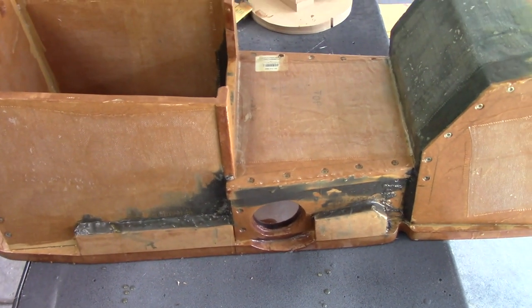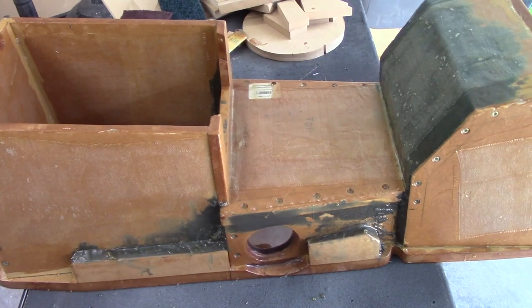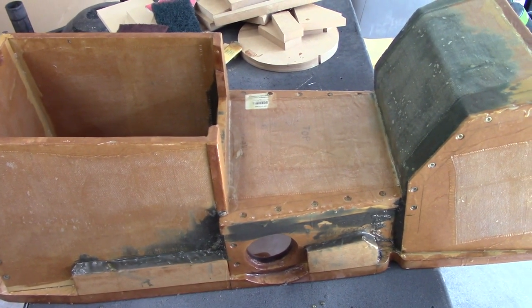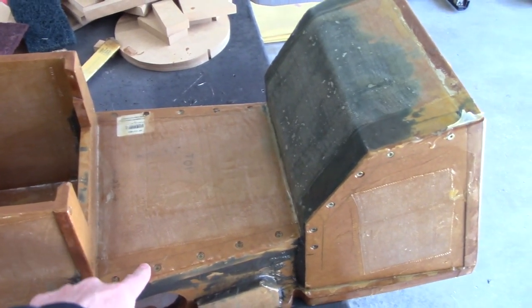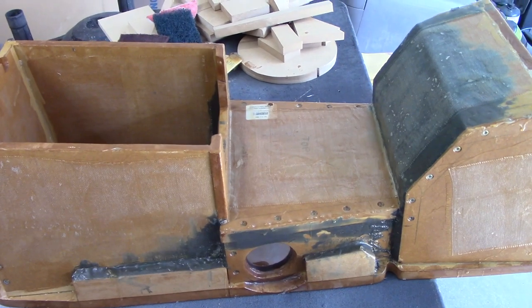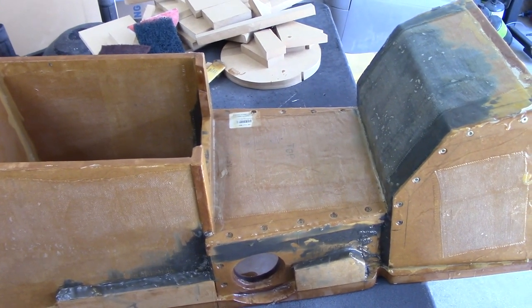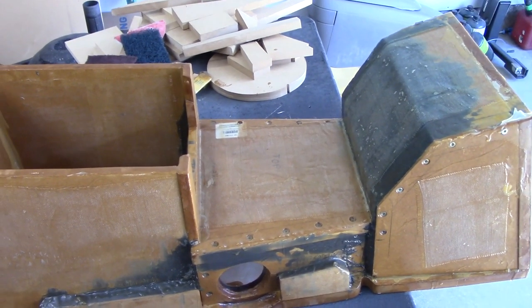Now the point here, and you look at this, and I know I'll get people that'll comment, oh, that's too much resin. Yeah, it's too much resin. Don't care. The point of the resin is not for strength. The 3/4 inch MDF is giving strength. Realize resin is basically a plastic. It becomes a plastic once you've actually mixed the two parts and applied it yourself. And that's what I'm looking for, is the waterproofing of it.